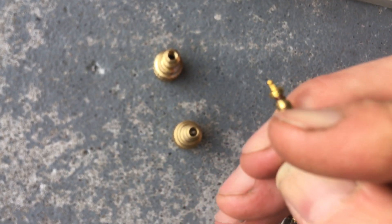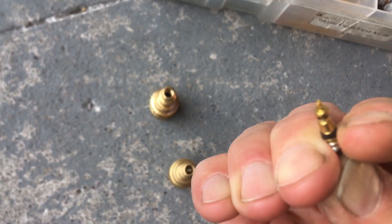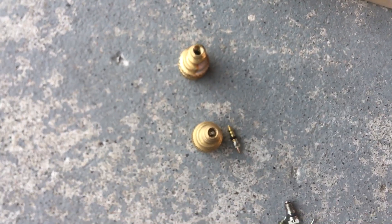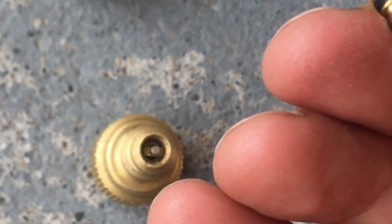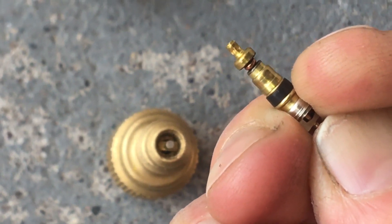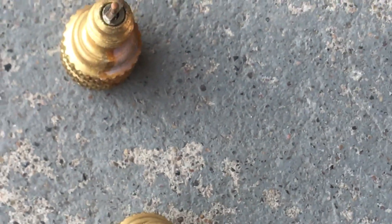Like a valve on a car engine where a piston opens up — if you actually look at it, there's a stem inside there, so the circumference is actually smaller than what you see. Let me zoom in. Basically you have a tube with a stem inside of it, and there's almost no opening at all. Your opening is less than those small openings on the side. There's a stem in there blocking even more flow. You have a stem, you have a hole, and you have a stem in the hole blocking — so you have almost no flow when you have a valve core.